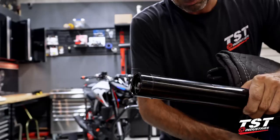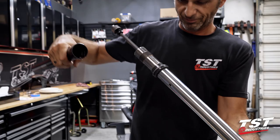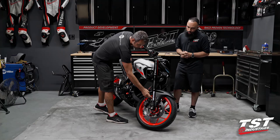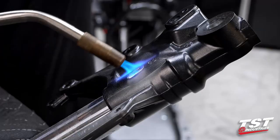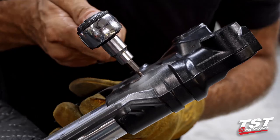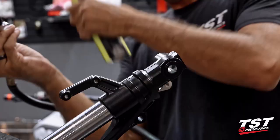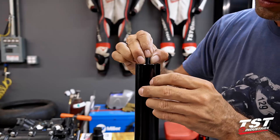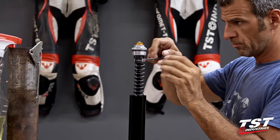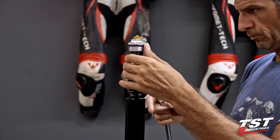On the compression side it's a bit more convoluted - everything has to come apart. You have to take out the clip, take out the dust seal, bang out the bushings and main seal, and disassemble the whole thing. Then you have to take the inner tube out of the stanchion. There's a set screw from inside that goes against the threads, and on this one it was galled up. I had to work through that little 8mm hole, muscle it out, clean off the threads, make sure all threads were restored, then rebuild it with the new cartridge components.